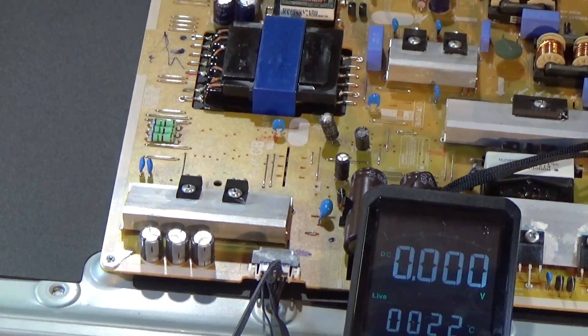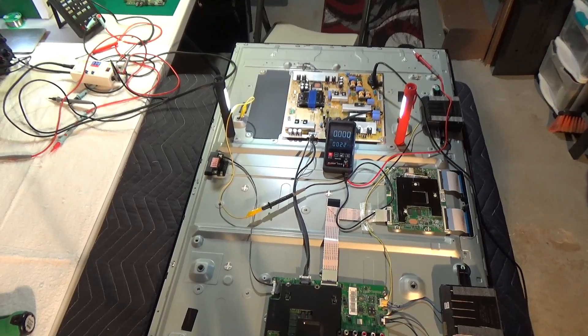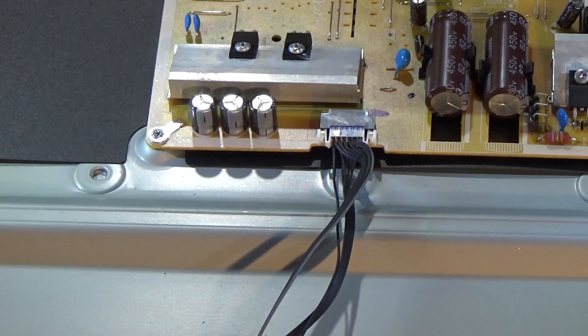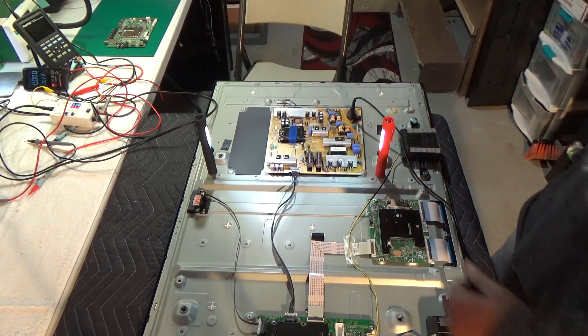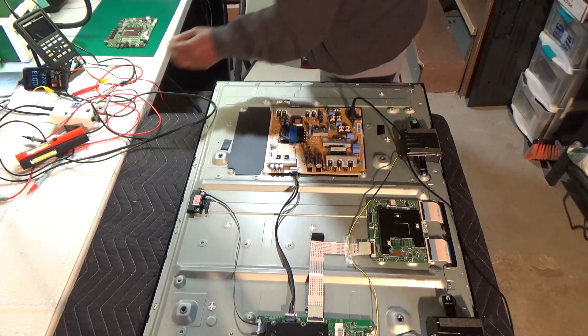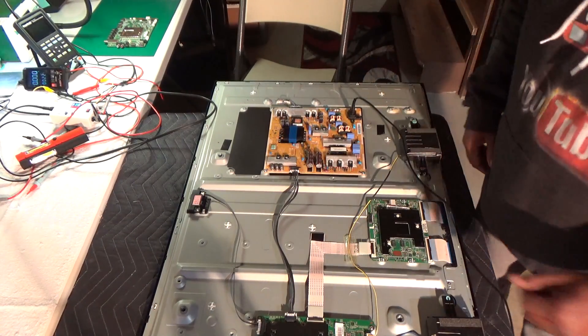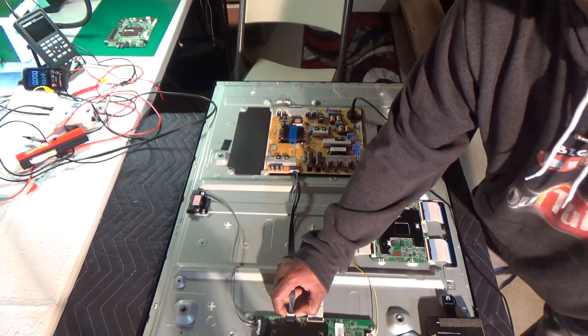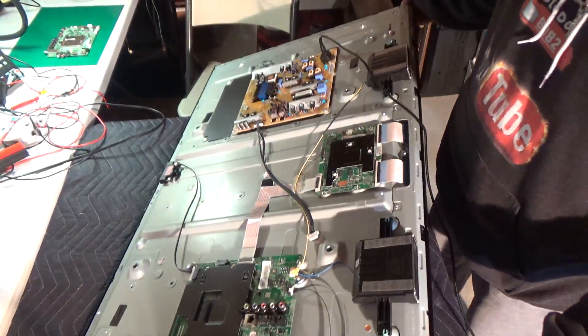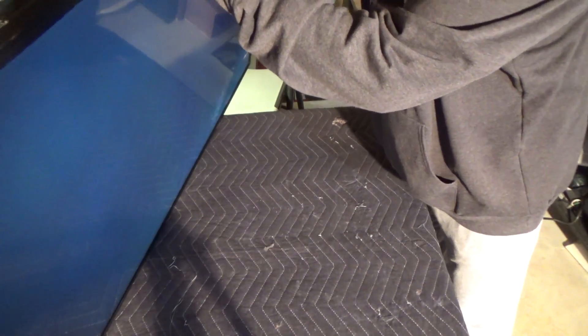Normally what you would do on this TV set — and I'm just going to get right to the point — is that anytime you see that type of plug on these Samsungs, on the power supply board and on the main board, here's a trick: all you have to do is unplug it. Once I unplug it from the power supply board — watch what happens. I got backlights! Full backlights. We have a lit screen. I'm going to unplug the power — screen went out.